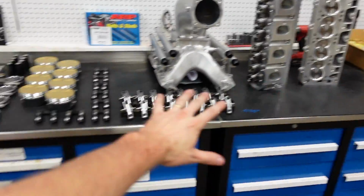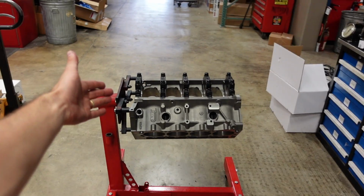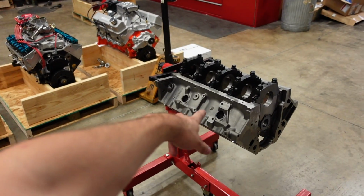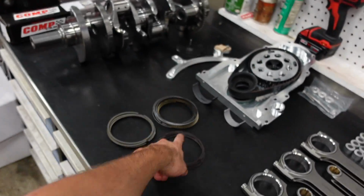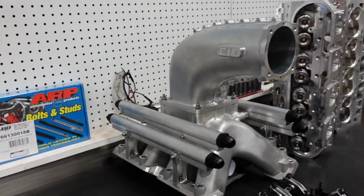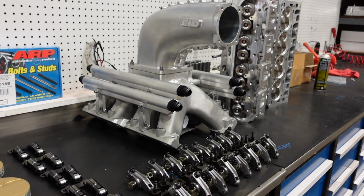So there are all the parts. In next week's video, or the next video I upload, I don't know, might be next week, might be tomorrow, I am going to hone this block in our CNC cylinder hone with the correct ring surface finish to run these piston rings in this application. That thing is literally like 20 inches tall. It's obsessive. I love every bit of it.